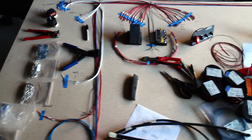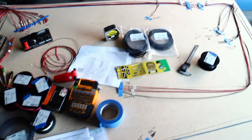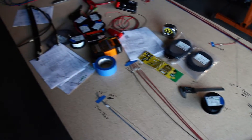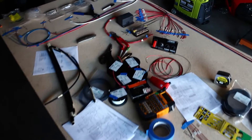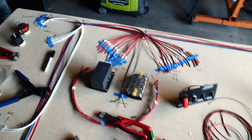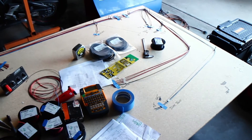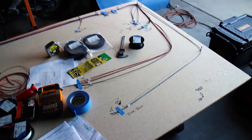We had a question from our last video: why are we using particle board to lay out our wiring harness for construction? The answer is pretty simple — it allows us to visualize and see the harness in a more complete manner rather than being crouched in the car trying to assemble all these wires going to the dash and the fuse panel. It makes it a lot less stressful, and we can make sure we have all the correct lengths ahead of time. Ideally we won't even be modifying this after it comes off the board — it'll just be plugging into the car.